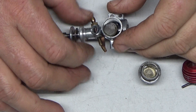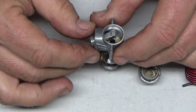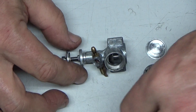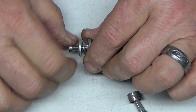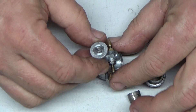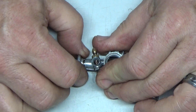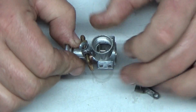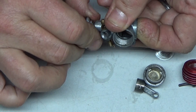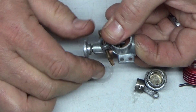Here's our nice little piston — it comes out, it's a cute little thing, and it didn't look like it was very dirty at all. Now the next issue: the design of this engine is such that this drive washer had little knurls on it, and the end of the crankshaft is knurled. Well, this thing is stripped, and it was stripped when I got it. Because it basically just spins on the crankshaft — so when I did get it to turn and put a prop on it to turn it over, I couldn't get it to turn the crank at all.